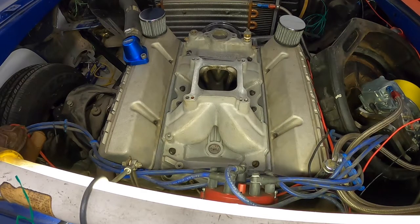You know, they tried to tell me, oh yeah, you floated the valves and caught a piston. And I said, well, I don't really think so. And it's hard to explain because the stem was still in the head, still attached, and it would still go up and down. And if it hit a piston hard enough to break the head off of the valve, you would think it would have bent it, but it didn't. Yeah. We took the keepers off and pulled it out and rolled it across the bench, and it wasn't even bent. And it was just like a clean break. Like, I don't know what happened to it.